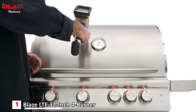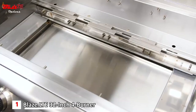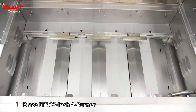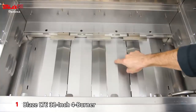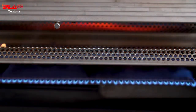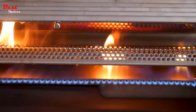Now we'll perform our XRF test on the Blaze LTE. The grids, burners, and exterior of the grill all tested to be 304 stainless steel. The interior walls of the firebox, flame tamers, heat zone separators, inner liner of the hood, and lower baffles all tested to be 443 stainless steel. Blaze uses 443 stainless in interior components because 443 has titanium added to its chemical composition as a hardening agent. Since titanium is in the stainless, this 443 is very stiff, and the lack of flex during heating and cooling cycles makes these parts very durable — a big reason why Blaze backs them with a lifetime warranty.